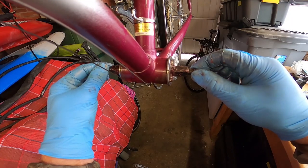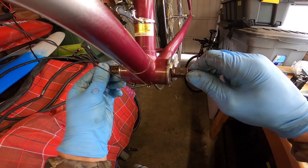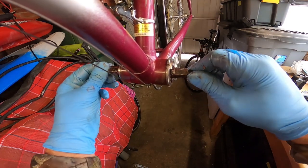You can see the free play that needs to be adjusted — we take the free play out and finely tune it, then lock it up with a locking ring or C-spanner before finally refitting the crankset.